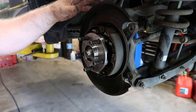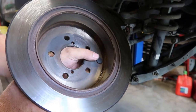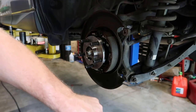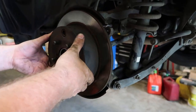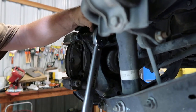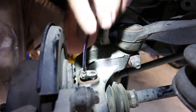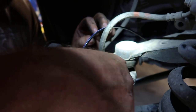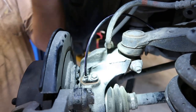I got the bolts torqued down to 48 foot pounds. Now I'm going to put my rotor on — you can see on the back side there I just took that little rubber adjustment plug out and I sanded the back side of my rotor and also the front side right here, so we're ready to put this back on. Torquing this brake bracket bolt to 48 foot pounds of torque. Then we're ready to install the speed sensor — just put your 10 millimeter bolt back in it. On the torque of this, it don't take much, just snug it down just a little bit. The caliper bolts here we're going to torque those to about 20 foot pounds of torque.